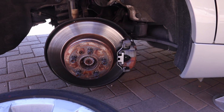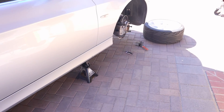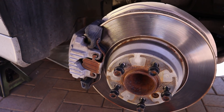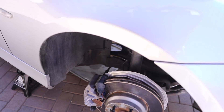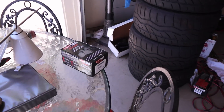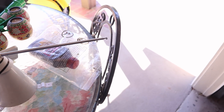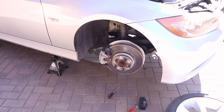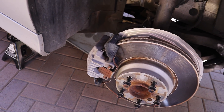As far as the brake pads go, I upgraded the brake pads but did not put racing pads on here. I went with some budget pads that I like to use on the track — these are good beginner brake pads when you're first starting out. You can see I got new pads in there; they forgot to give me new hardware unfortunately. The pads I went with are these StopTech Sport pads, which are great because they're rated up to 1,300 degrees Fahrenheit. I really like them for beginners starting out on the track.